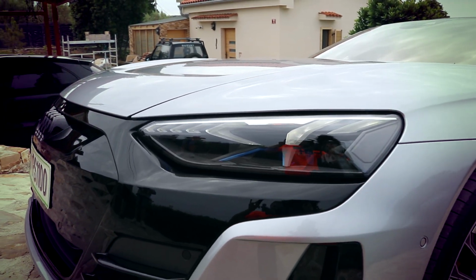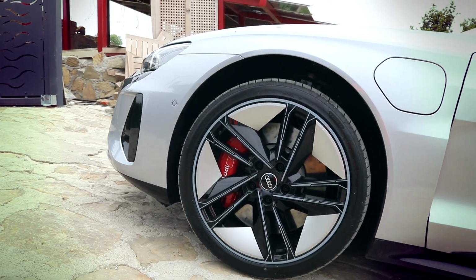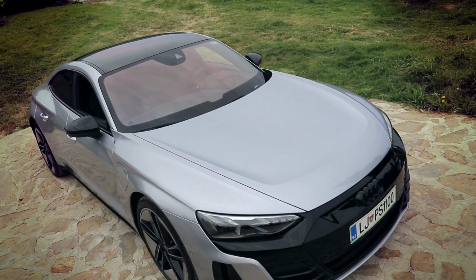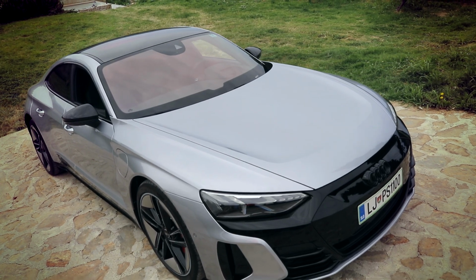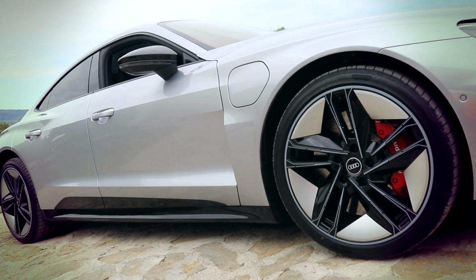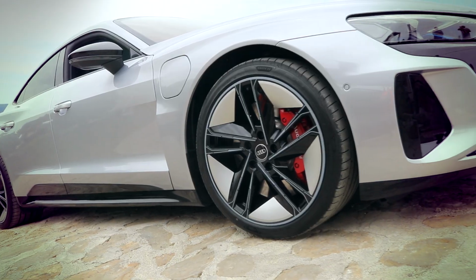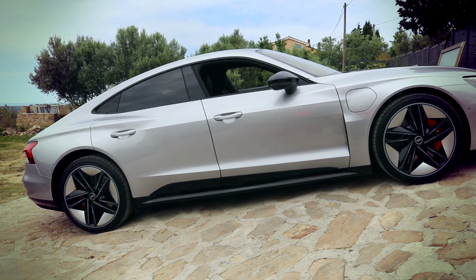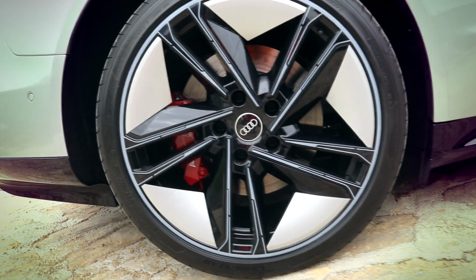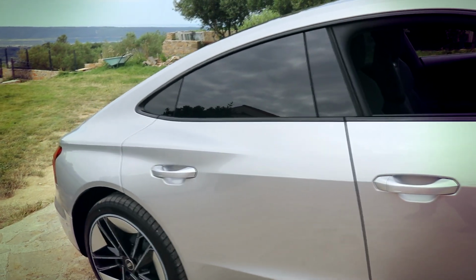The sporty car has, despite some rather impressive regenerative braking abilities, the option of standard, carbide, and carbon ceramic brakes. This RS version has carbide brakes as standard, which are rust resistant and apparently produce up to 90% less brake dust. Although with 265 kilowatts of regenerative braking, mechanical brakes most likely won't be used very much.